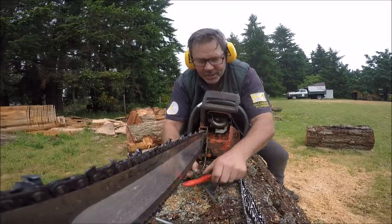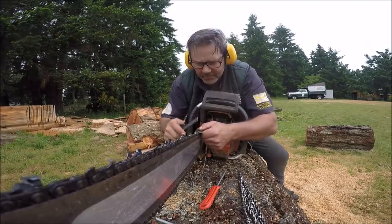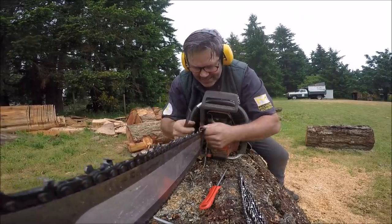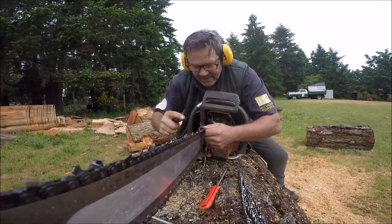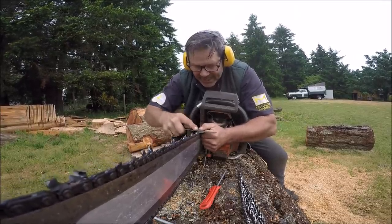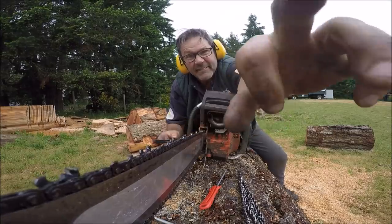Okay? Let's check raker heights real quick, friends. We'll go soft. No, we won't. We'll go hard. Yep. Oh, yeah. They're actually good. See how much more you take off with the hand file, friends? Talk to you in a minute.